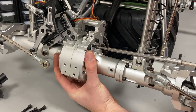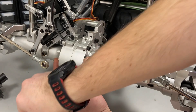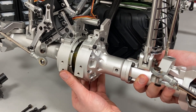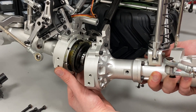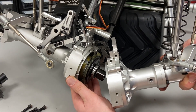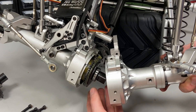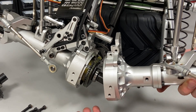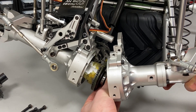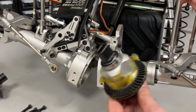Once it gets to the very end it's loose, and now there's nothing holding this together — it'll slide open and you'll have it in two halves. You just kind of let it hang down. The one thing you really want to make sure of is the orientation of the diff. Put the new one in the same orientation it came out, otherwise the front and rear axles will spin in opposite directions.